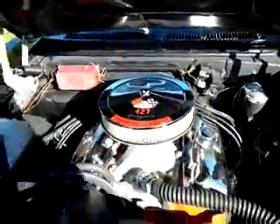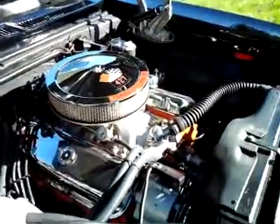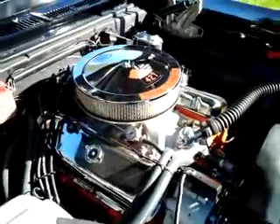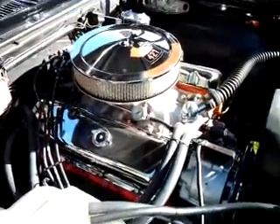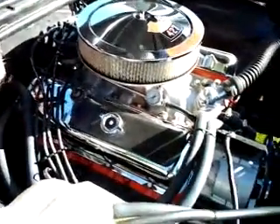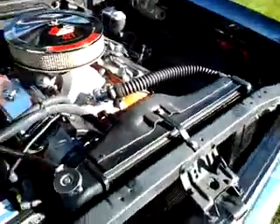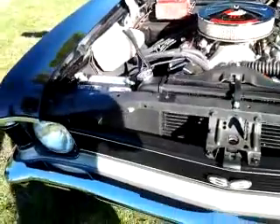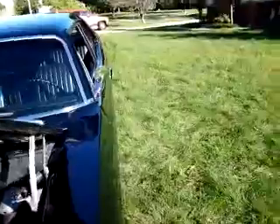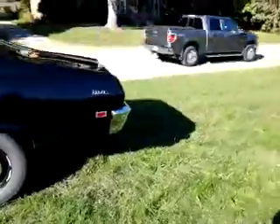The 427 big block Chevy engine runs really well. It was just freshened up seven months ago. The heads received all new valve guides and a valve job, guides were honed, new stainless steel valves — all 16 of them — competition cam valve springs, ARP studs, rocker studs. It's tuned really well, runs really good. A really fast car — one of the fastest ones I've ever driven, actually, if not the fastest. Nicely done car.